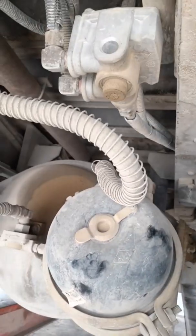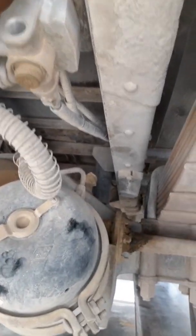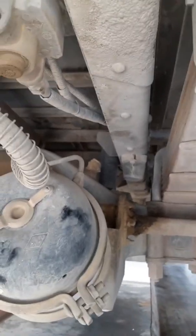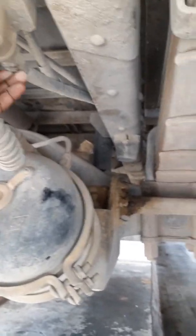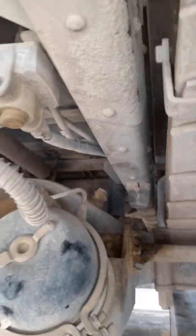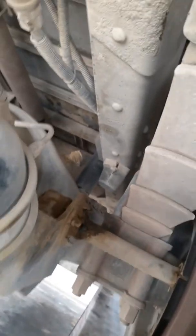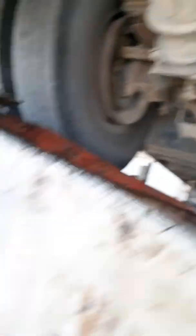If you are making an emergency brake, you will need a high-pressure signal — you press the pedal fully, full pressure comes here, the valve opens fully, high air pressure flows, and it will stop the vehicle. That's how the brakes work in an emergency situation.